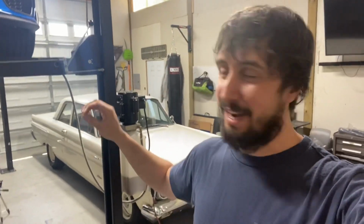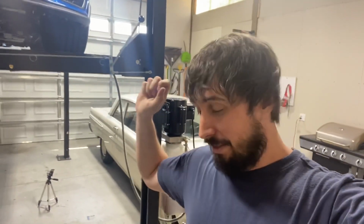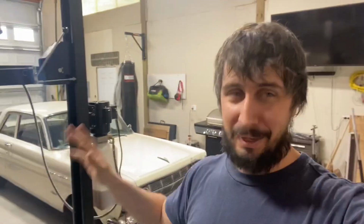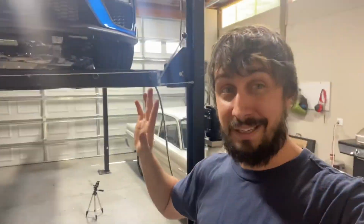You guys got all weird last time in the comments when I changed oil in this thing, like, oh, you gotta follow the manual and you put the seal on dry. Fine, I'll follow the manual and I won't lubricate the seal, and I'll tighten it to 44 inch-pounds, which by the way is not very much. Divide it by 12, tell me what you get. So anyways, we'll do that so I can just avoid it in the comments.